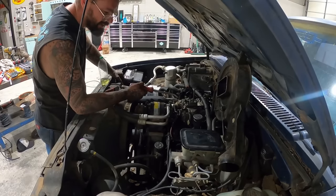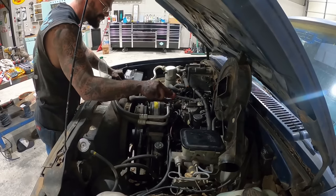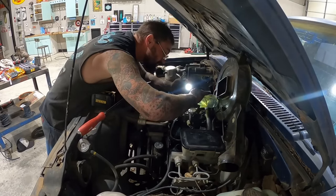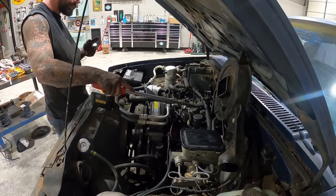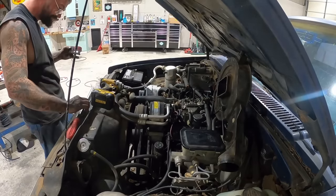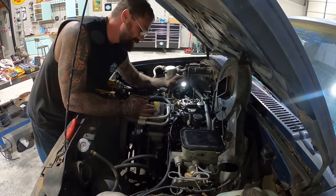It's running on gas when we give it gas, but it's acting like it ain't getting gas, but we know we're getting gas up to here, then maybe our float's stuck. Oh yeah, she's dry in there, but why? Fuel's just dumping now, flowing straight out of there into there. The good news is, it's running freaking amazing whenever it wants to run. The bad news is, still ain't getting no fuel.